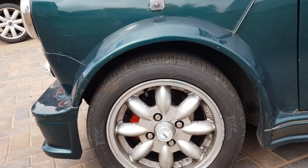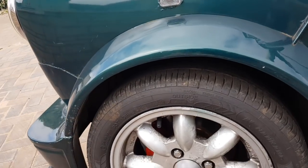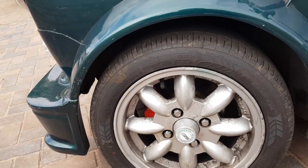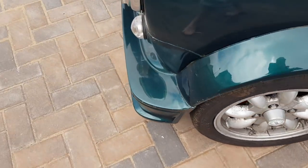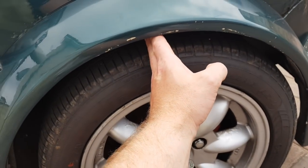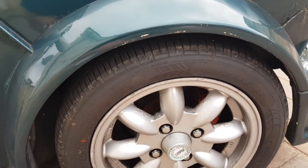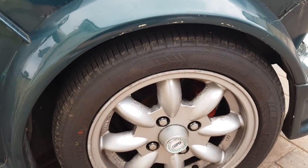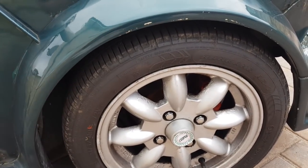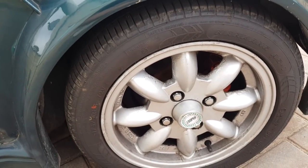I came back after the car has done quite a few miles to show how much the suspension drops and levels out. You can see here - three and a half fingers worth - so I will need to adjust it to get it set right. The other side is about the same. It's now done about 300-350 miles since I changed it, which just shows how much it actually drops in that time and how you need to keep an eye on it to get things set up correctly.